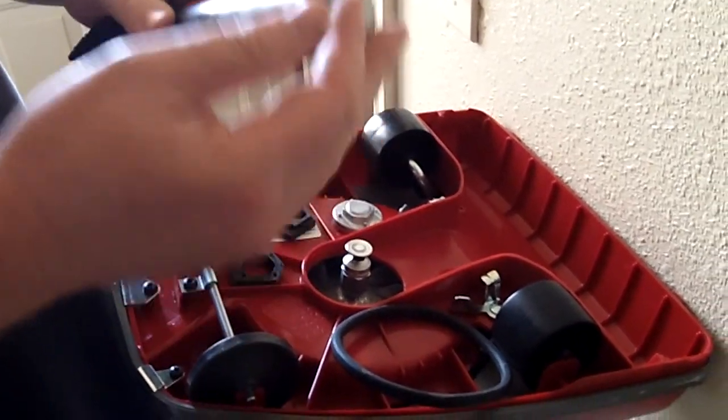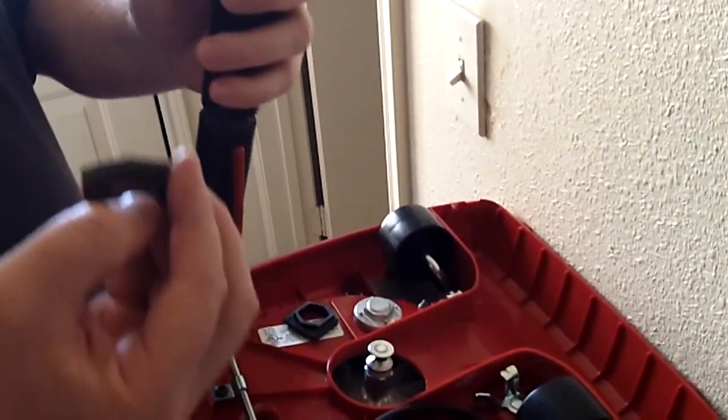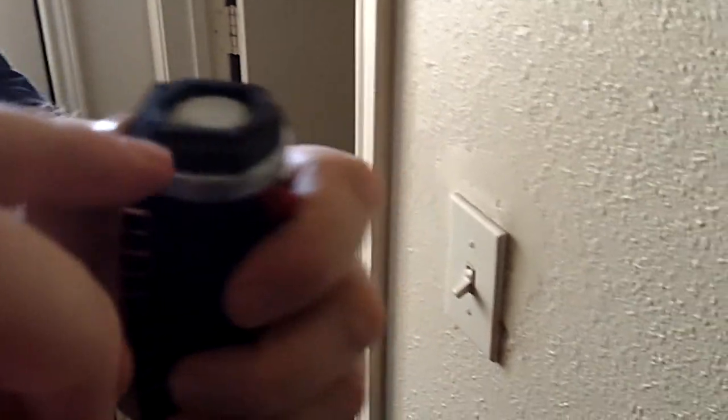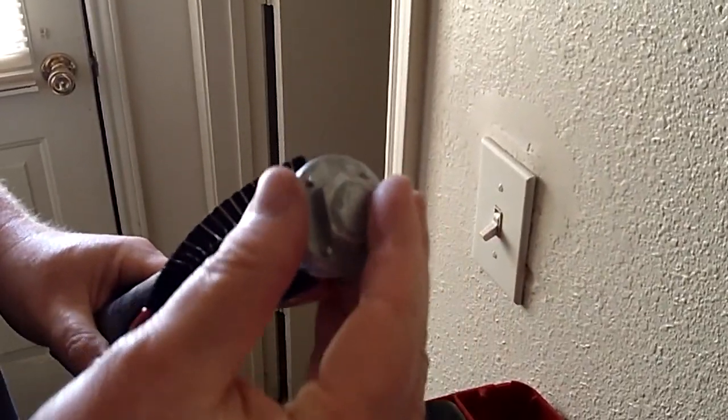So you put these on first, put on your end caps, make sure they go nice and smooth. Now these come right off, they fall off, so don't worry if it comes apart. But if you see this thing here, there's a little ridge on the outside here, and you want to put that to the outside. So you want to line this up right here with these pins and find a spot where it sits and put it on like that. And then you should have the shorter hex pieces sticking to the outside, and the flat part goes against the bearing cap. And then you want to kind of hold on to those because they'll fall right off again on you.